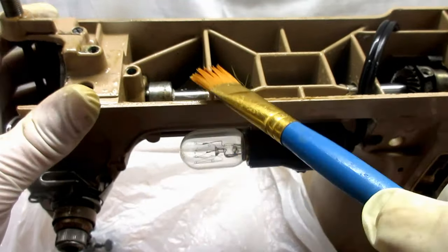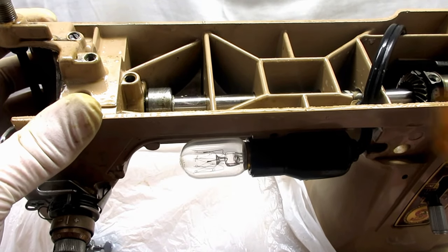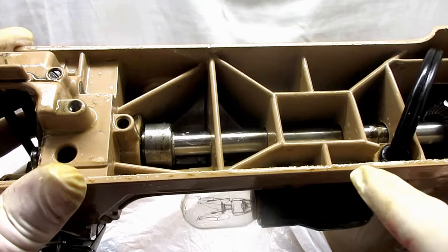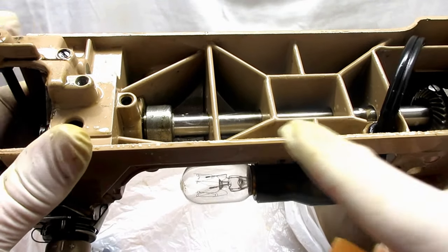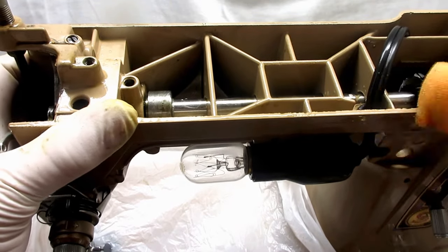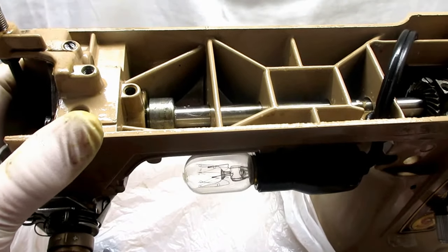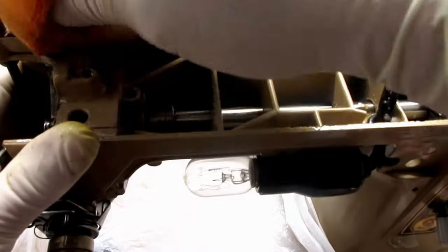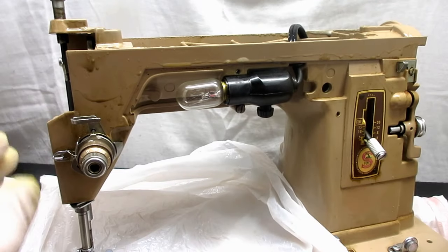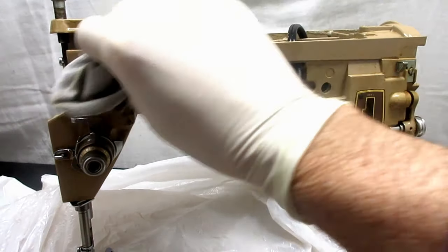Now I've also treated this top ledge. This top edge seems to have a habit, as well as the bottom of the arm cover where that mates with this, of getting a few layers of this dried up oil on here. I'm not sure if you can see it, but it can be very stubborn right there. So that's one of the reasons I take my sponge. This I'm going to dip in the 50%, and I'll have to scrub that, because sometimes just brushing it on and washing it off doesn't always clear that part up. Okay, so I'll give that a little scrub to be sure that's going to rinse off. And then I want to dry the overflow of the crud cutter off of here, because I don't want it dulling that paint.